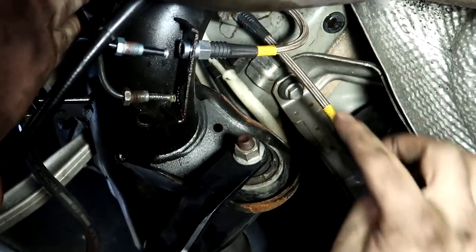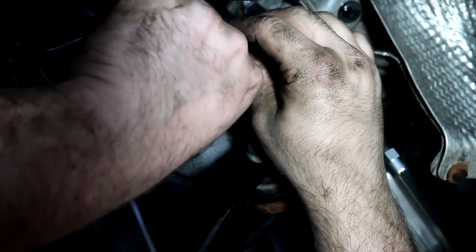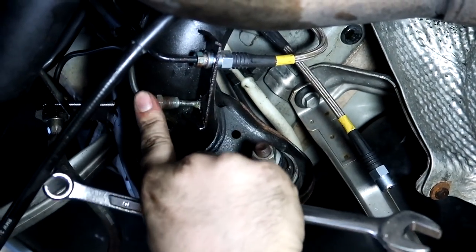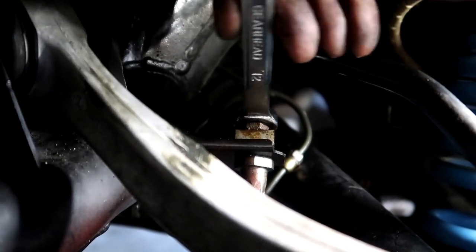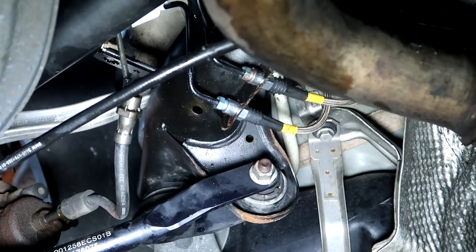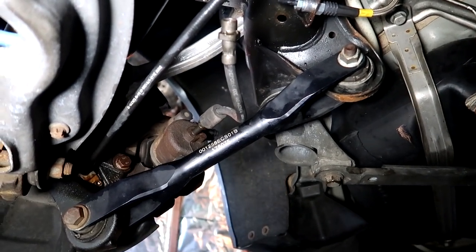These two top ones are tight up here so I'm just going to connect them to the other parts - very simple. Finally getting rid of my AutoZone brake lines, which is exciting. Now I'm going to take this one off because I'm replacing this with a new line. Taking this brake line off. This intersection right here is now done, all good. I don't have the little clippy things for here, so whatever - I don't give a damn. I can move on up here.